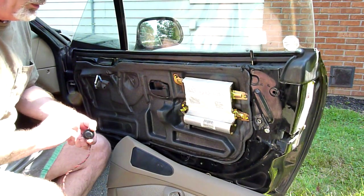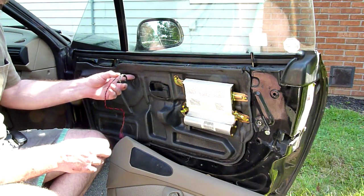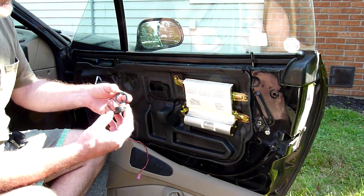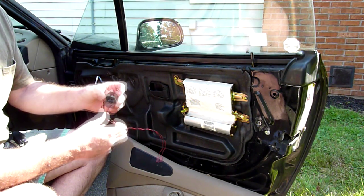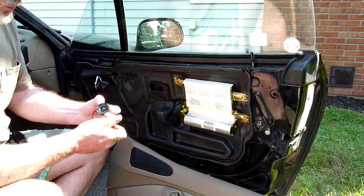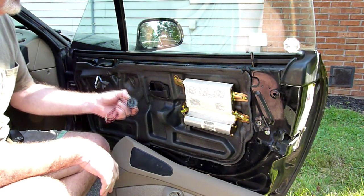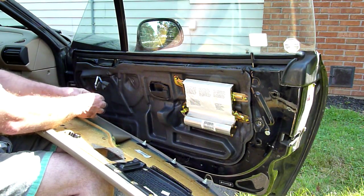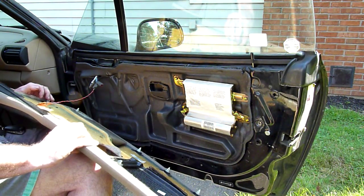What we have left to do today is put the door panel back on. These cars are pretty old — this panel hasn't been off in 13 years. These little speakers: there's a ring on the back of the speaker and the glue has let go. There are two very tiny wires that broke off and are virtually not repairable, so I'm not going to put this speaker back on. Once I replaced my stereo with a higher powered stereo, it blew most of the speakers anyway. The other speaker wire — black to black — just snaps back in place.